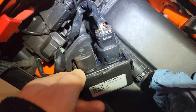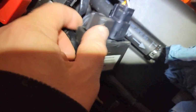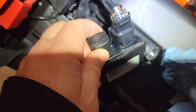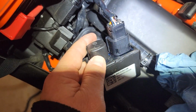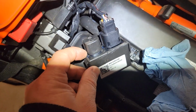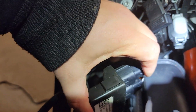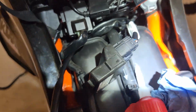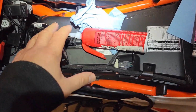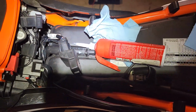Okay, now we're going to remove this little rubber clamp. Here's our heated grips on this attachment, and let's unplug this and plug the heated seat harness into that. I'm going to use a little dielectric grease on there. Isn't a real high water area, but it won't hurt. Here we are, has some dielectric grease on there. We're just kind of plugging that in. There we go. And it does appear that feeding this wire off to the left is going to be the best route, since the driver's seat wiring plug-in is on the left-hand side. Then we won't have to cross under the seat.